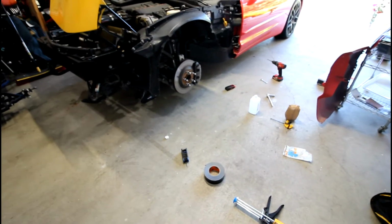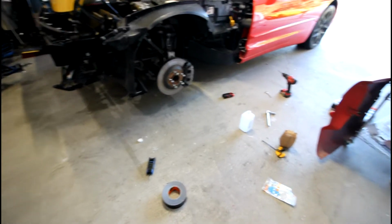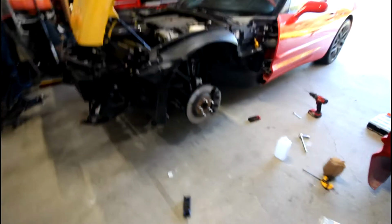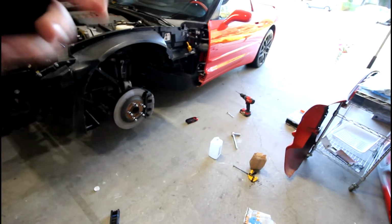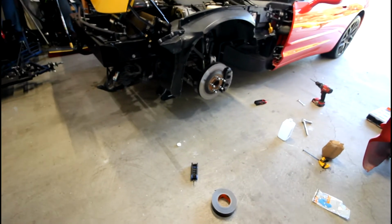One other last thing I wanted to mention is if you do get this glue or epoxy on the ground, because it's kind of inevitable when you pump this stuff up, and unless you take the pressure off, it just keeps coming out. So it's kind of hard. You have to do that many times while you're putting the glue in all the different spots. If you do get glue on your concrete floor, try and wipe it up right away if you can. Rubbing alcohol works the best, just to wipe it with some paper towels and it comes right off pretty easily.